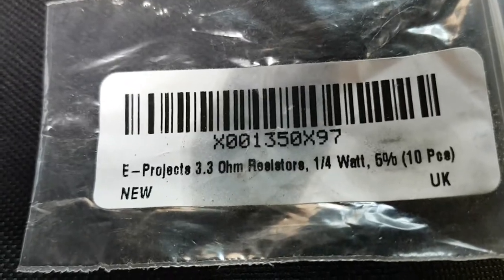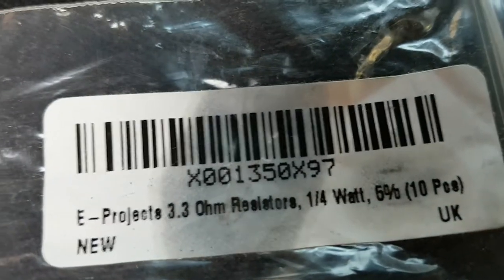Good day! Seeing on one of the forum rooms, this one's asking how to turn the airbag light off after they swapped over their driver's seat. I fixed my seat and I'll show you how to do it — pretty simple really. You can get the resistors from Amazon, I think they're about four quid — I bought ten for about four quid. You only need one. These are the resistors you need, right here.